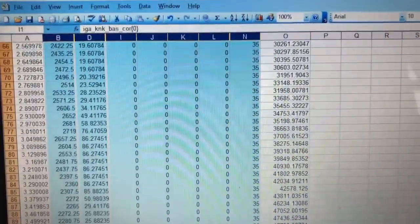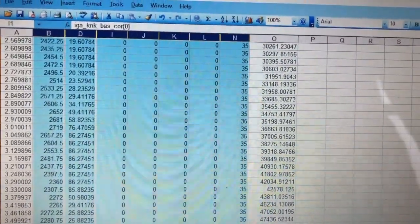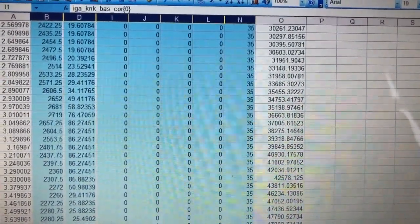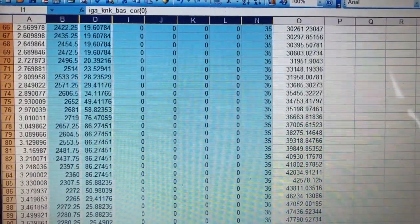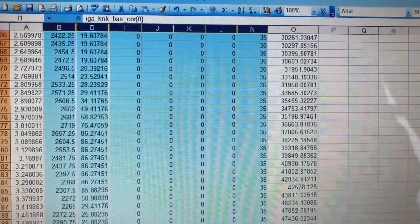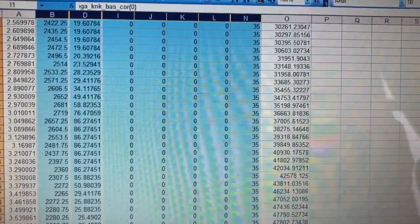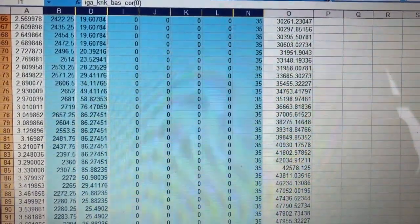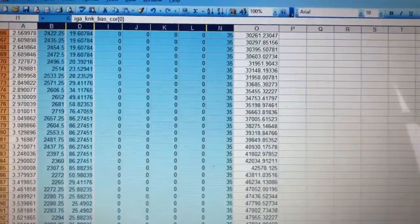This is a standard engine Golf 7.5R running the TurboDirect IS38600 at 1.4 bar boost with a 76mm downpipe going back into the standard resonator, the 63mm silencer box and original system. We have a stock intercooler and a 4 inch 102mm air intake pipe, plus software and AEM water meth injection. No intercooler upgrade, no charge pipe upgrade, no full exhaust yet. 1.4 bar boost, no ignition retard - not a bad result. I'm happy with the logs and we'll carry on with more tuning.